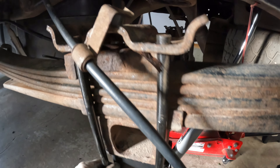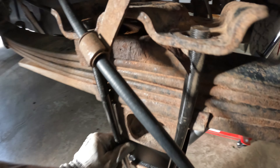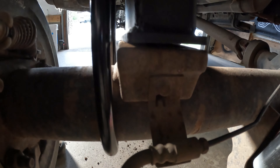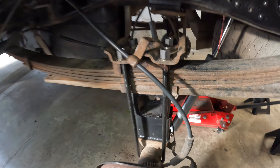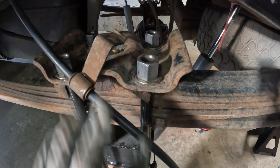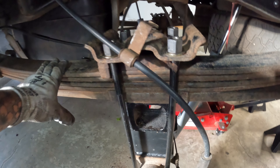I still have to grind a little bit to get that to sit flush — the nub on the bottom is a little big so I've been grinding it down in a circle. I think we'll have her fitting. There's only about five threads sticking through, but I can see a space between the axle tube and the u-bolt — I think when we tighten it down we'll sink it in and be okay. Let's get rid of that four-millimeter gap. The new hardware from the Super Lift brand is way nicer — thicker — but since it's thicker we're not all the way through.